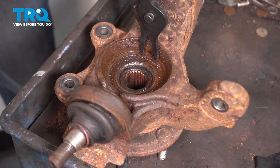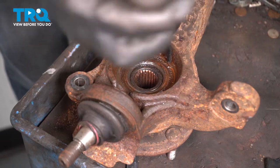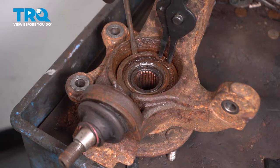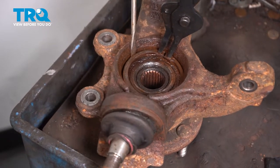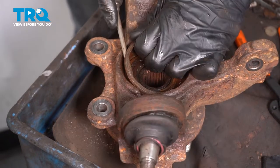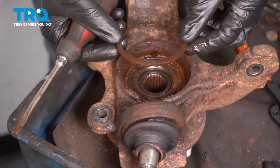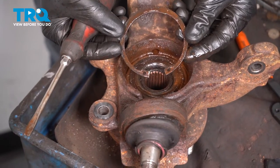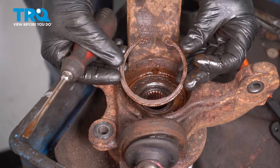Once you've done that, make your way in here. Keep in mind that this is under spring pressure. You need to be wearing hand and eye protection at all times. Once you have it squeezed, I'll gently start prying with a screwdriver or small prying device. Work it out of its groove. I'll hold this under control while I fully remove it. Once you have it off of there, go ahead and clean it down and give it a thorough inspection. Make sure it is still reusable. If it looks like it's worn or damaged in any way, replace it.